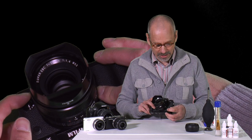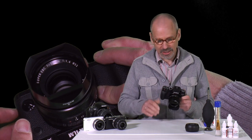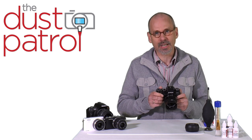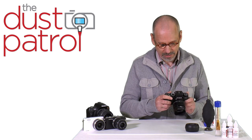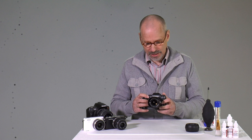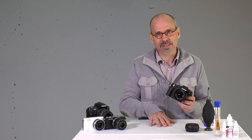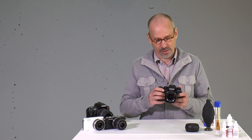And you set the camera to manual focus. You want to take a test picture against a white piece of paper, and setting the camera to manual focus allows the camera to release the shutter. While taking the picture I swipe slowly across the piece of paper, so I avoid capturing any dust which is on the piece of paper. I only want dust which is on the sensor.